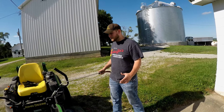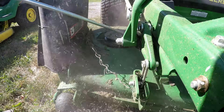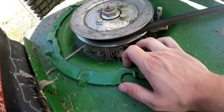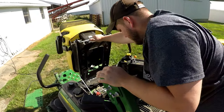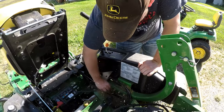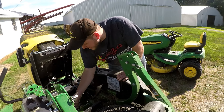I'm going to start blowing these off — I'll take you to a little time lapse with some cool shots. It's important to clean out under the pulleys; there are little grooves where rocks get stuck. You may have to use your hand to pull some of the grass out. After blowing off the bottom, go ahead and lift up the seat — under the battery there are fans under there and if they get clogged up with grass, that's not good. You should probably do this after every mowing.